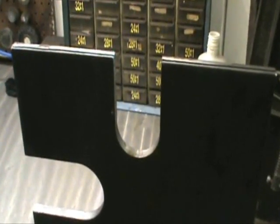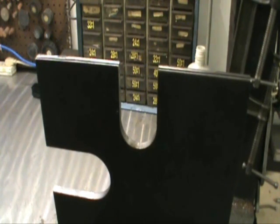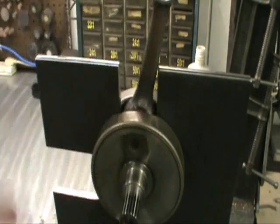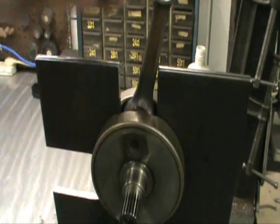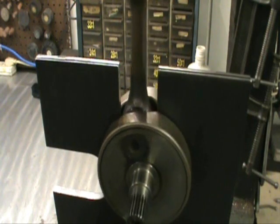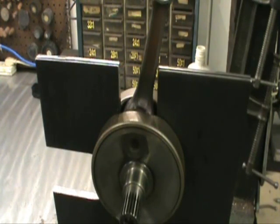This is one of several press plates that we use — we build them right in here to do the disassembly of the crankshaft. We just slide the crank inside of it, set it up on a press 90 degrees inverted, then drive this pin to separate the web from the crank, and go in the opposite direction to take the pin out the other way. You really don't want to press the pin through everything at the same time — it generates too much force. The reason we can't just press it normally is because these tin cans are sheet metal and they'll compress, bulge out, and distort everything.